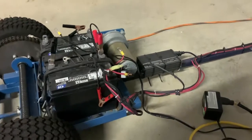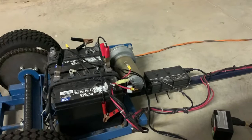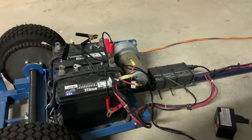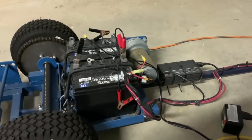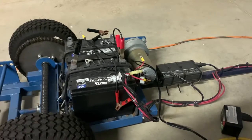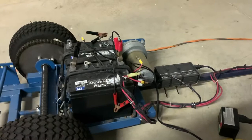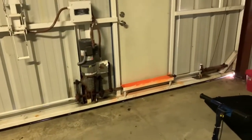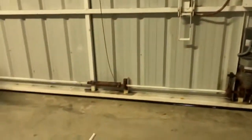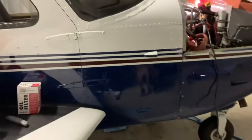I was going to dig into it more when Steve stopped by to show me the safety wire. He asked, 'Did you check the fuse yet for the charging?' I said no — I figured I'd check it if all else fails. Well, all else failed. I popped the fuse out — five amp, 200-something volt — and it's burned. That's why we're not getting a charge. I'm going to pick up a fuse today and just individually charge each battery for now.